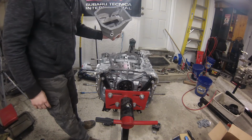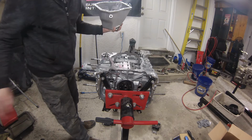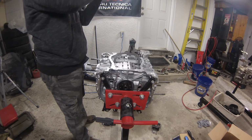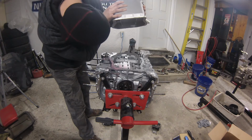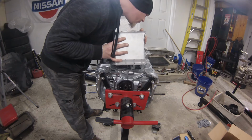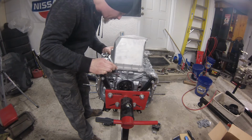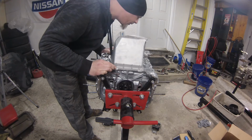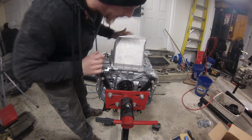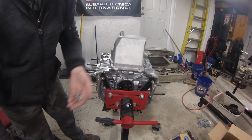So it's probably close to 10 minutes later. The stuff is still damp feeling, but I can feel it's very, very tacky. So without touching anything or touching any of the sealant, I'm going to try and guide this down. Just give it a little wiggle to make sure the sealant is applied everywhere, and just start threading in these new Allen head bolts by hand.